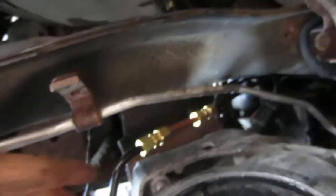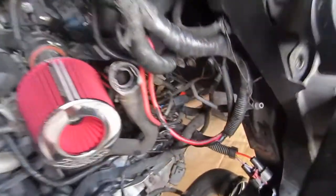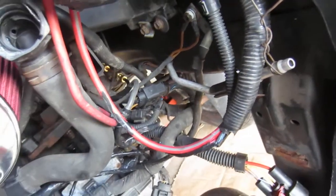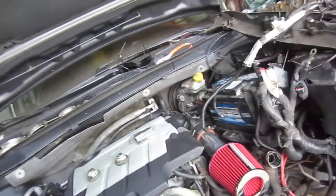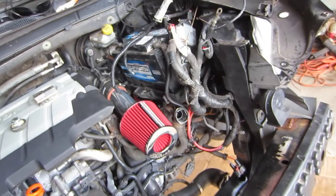The wiring is almost done — the under-hood wiring is done and I just have to plug this in. When the air conditioning switches on, I'm going to have a heavy-duty relay teed off in parallel into this circuit so it can turn the air conditioning fans on at the same time as the compressor. The relay will be controlled by the Chrysler dash controls.